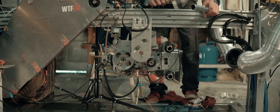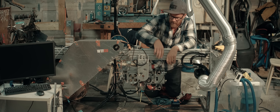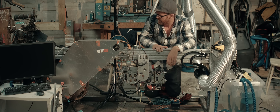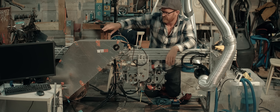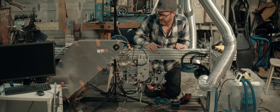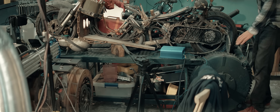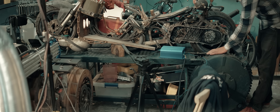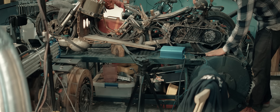I need to order sprockets and a chain. For new viewers, what you're seeing here is my home-built dyno with my home-built custom prototype engine mounted to it. The dyno consists of a retarder — a magnetic brake out of a truck — and this framework around it, and some sensors and stuff. It's actually my second home-built dyno. I've got this one too — it's an inertia dyno. It hasn't seen much use lately, though we had my friend's blown engine up here for testing just recently.